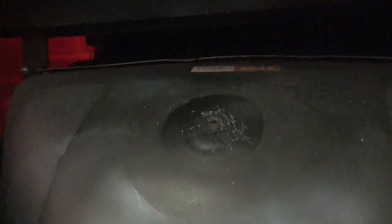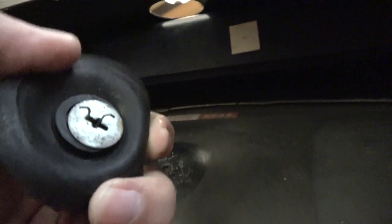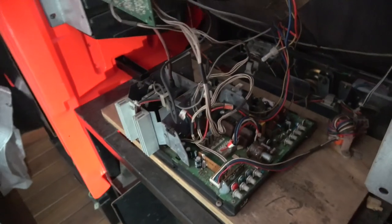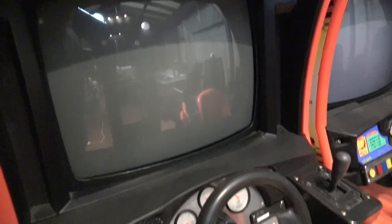I have gone and discharged this again, even though it hasn't been plugged in - just a matter of habit to make sure it is discharged regardless. Best to be safe than sorry. I need to get those two little clips into the hole and then they'll lock in, and the anode cap is now on. Let's fire this thing up - the picture will probably need adjusting, so let's just see what we get.